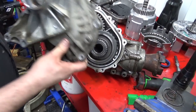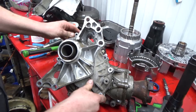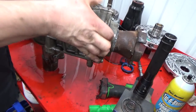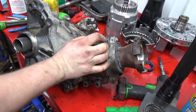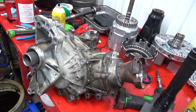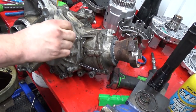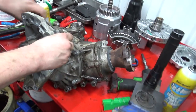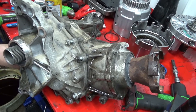We got the new sealant already. I'll just gingerly put this back on. You've got to do that to get all the bearings and races lined up. Then finger-start most of these, stand it up again so everything is seated, and then tighten them down.